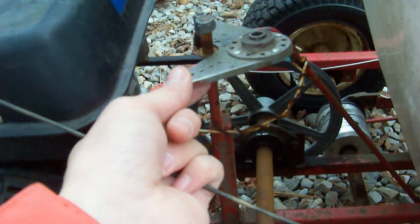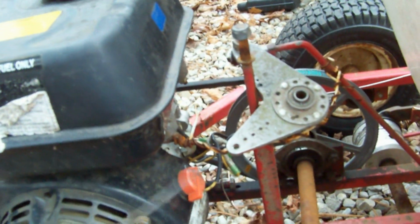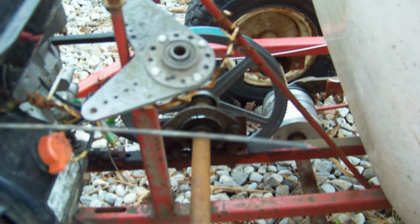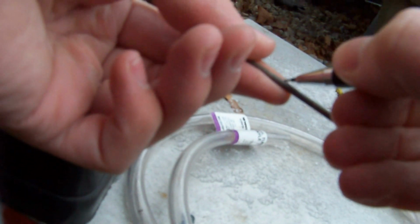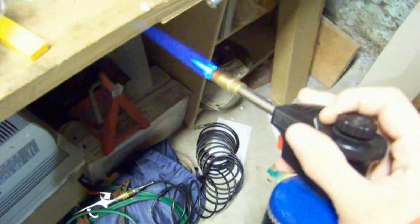So anyway, I want to press this back into service on the go-kart, so I have to bend it so it drops down and goes under here. So I gotta measure it now. Dang it. Here we go. Somewhat aligned. Okay, let's go inside and heat it up. Alright, I got it in the vise. Little mark is there, but you can't really see it. I'm going to heat it up with a torch and bend it to something like a 45 degree angle.